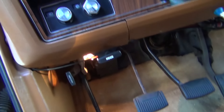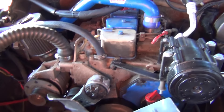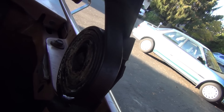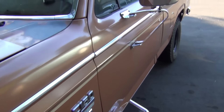I sprayed the e-brake assembly and that's working a little bit better. On the hood — I use it quite frequently since I'm always doing maintenance or modifications to this engine or adding stuff like the air conditioning. I take WD-40 — I tried lithium grease before but don't do that, it just gets everywhere — and lubricated all the pivot points, the spring and hinge. I did the same on the other side. Now it just shuts like a brand new hood.